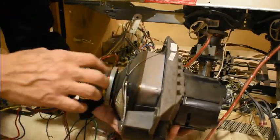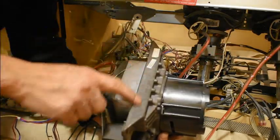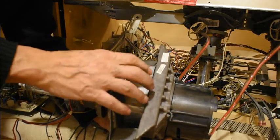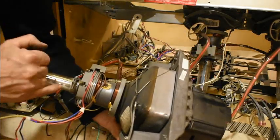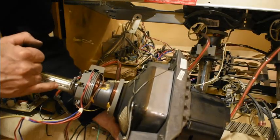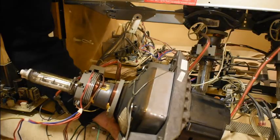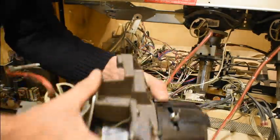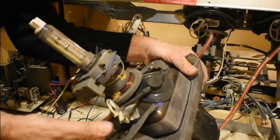We have the CRT part and the lens assembly. This heatsink also has a liquid inside to aid cooling and get the heat off the phosphor screen. The gun has electrostatic focusing and electromagnetic deflection, and this is the large anode connection coming in here with high voltage.